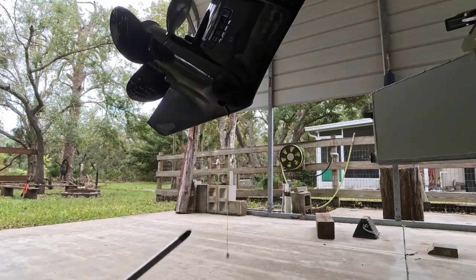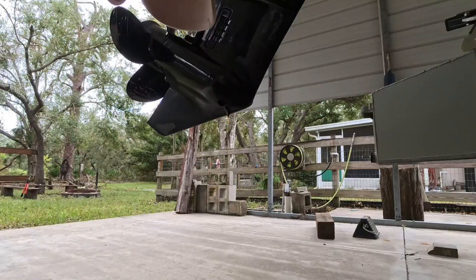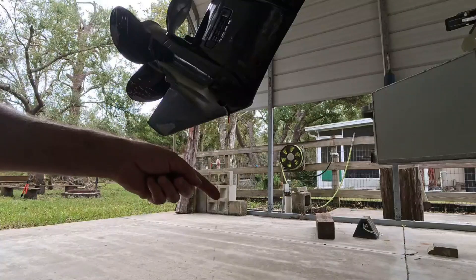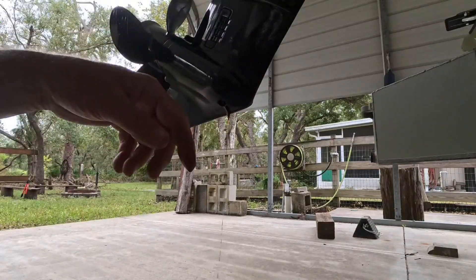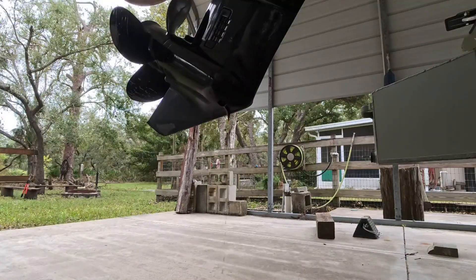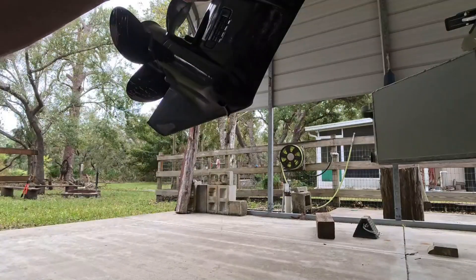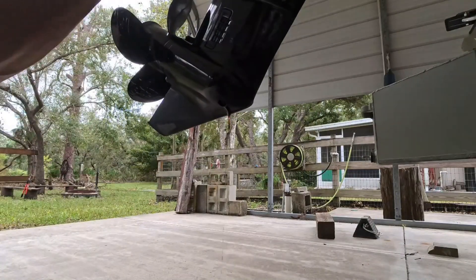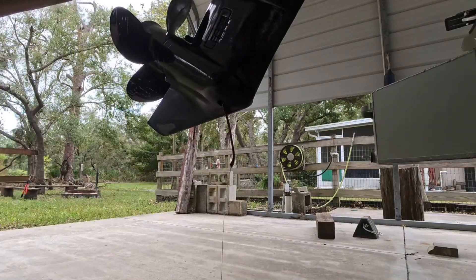You can see that's just barely coming out because we haven't taken our top screw out yet. I'm gonna let that come out slow for a minute — I want to look at it and it's just normal looking oil. What you're looking for is to make sure there's no milkiness to it. If it's milky looking, you know you've got water in your lower unit and that's bad — you've got to go get it serviced. But we don't have that — that's just dirty oil, it just needs to be changed. It's just time.